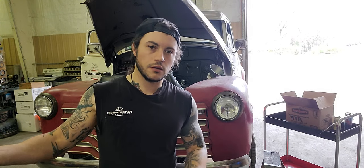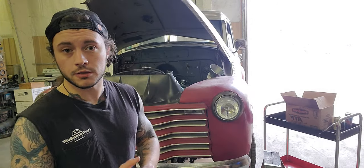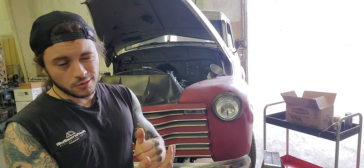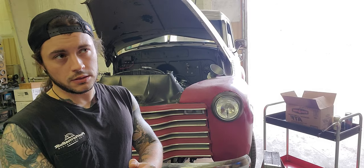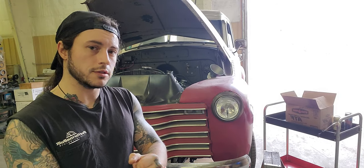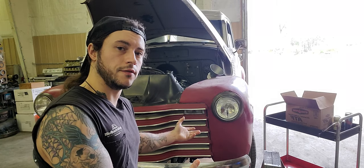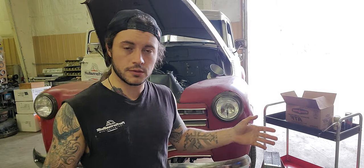My co-worker here, Frank, who I'm sure you guys have had the pleasure of speaking with, has a '95 Impala SS. He's running a level 3 4L60E, a 9.5-inch triple disc billet torque converter, and a cooler just like we send. He takes almost exactly, I think he said, 9 to 9.5 quarts. I forget which number, but as you can see, we're either a half to a quart off of being over full between the two builds.